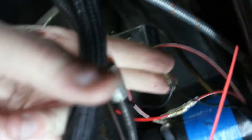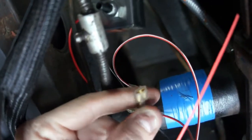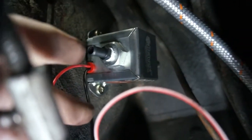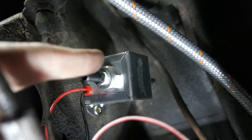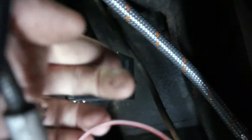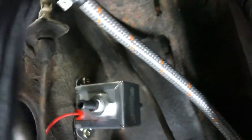The other red and white wire goes to a connection and then on to the electric pump. Both negatives are wired in and will be connected to the SU terminal where the negative came off originally. I'm gonna put the SU pump back in — it looks like having a straight through. There's a black fitting that came with the electric pump and another one on top, so it's basically a straight through. The new braided steel line for the SU pump will wrap up and around, with the inlet on top and the outlet below.